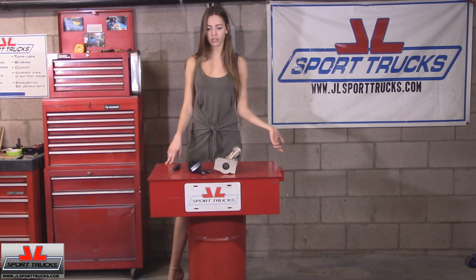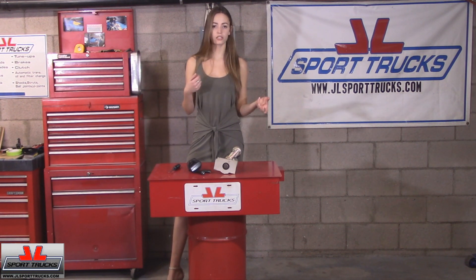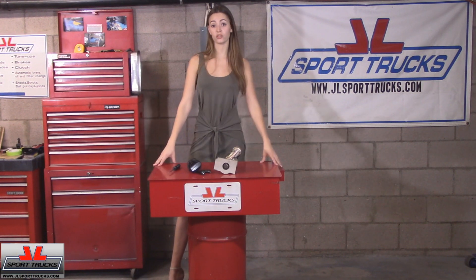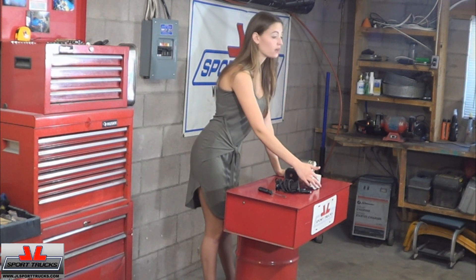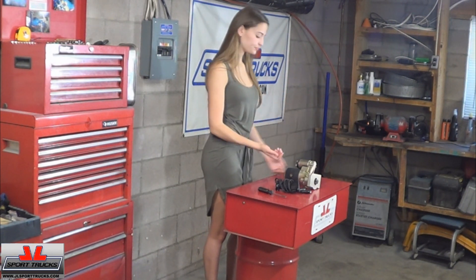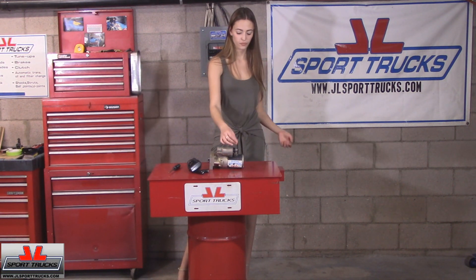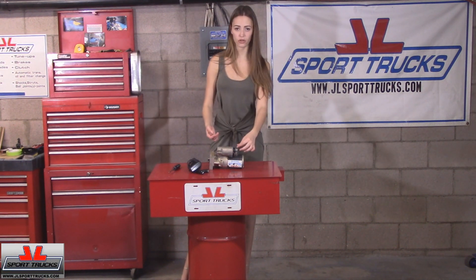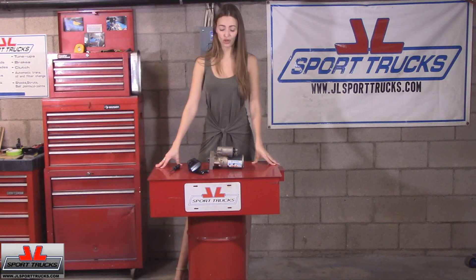This is found in your engine, and primarily if something's not working — your car isn't starting, or something's spinning and you're just not sure — you can do a bench test, which is what we're going to do here. This is your Bendix gear, and it comes out if it's functioning correctly; it's going to connect to your flywheel, which is going to start that spinning. On the side here we have the solenoid, and then you have the part where your cables are going to connect to see if there's any power. So one part is going to be the battery, and then this is another part.